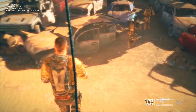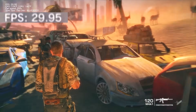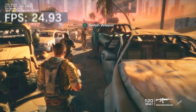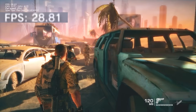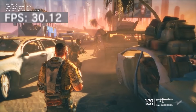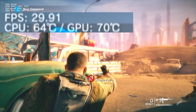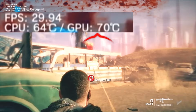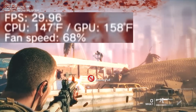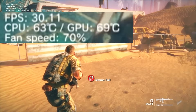Finally, let's take another look at Spec Ops: The Line. With the overclock applied, the game still had frame rate drops into the mid-20s, but they aren't quite as frequent as they were. I also didn't notice any major hitches during this test, and I want to say the game felt smoother to control, but that could just be placebo effect. One thing to note here is that the RSX did peak at 70 degrees, which is technically above the PS3's thermal target, and the fan spun all the way up to 70% speed at one point, which is really loud.